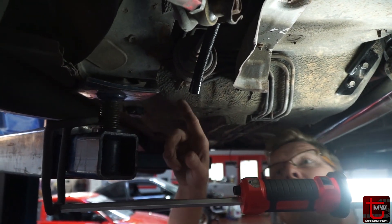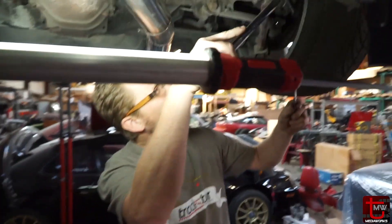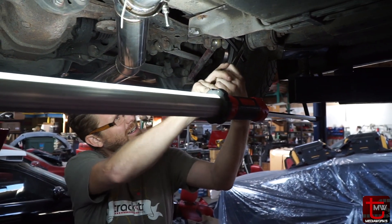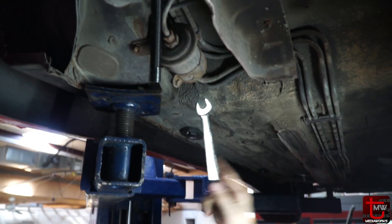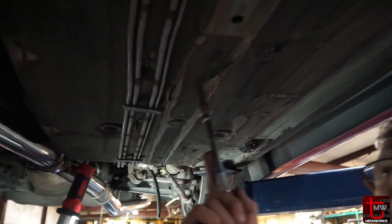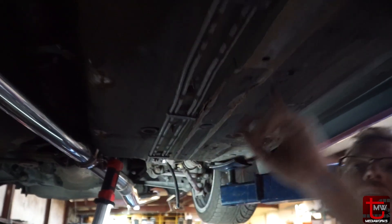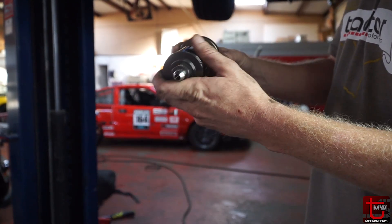Let's see, I need a 10 and I need to crack these guys free — I think 19 and 14. All the fuel that came out yesterday means I'm not going to have to deal with any pressure. It's definitely not under pressure — you're not going to have anything shoot out at your camera, Ryan. The frame rail here where we're going to run the fuel lines — it looks like Evan did some grinding with this car. This whole piece has taken hits, which makes me a little bit worried. So we got our new fuel filter, part of it at least — I don't have the whole element in there — and then our mount.